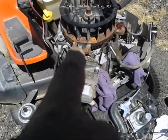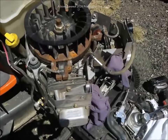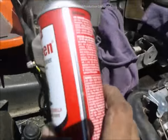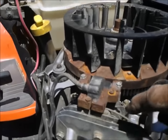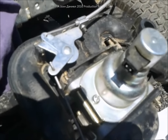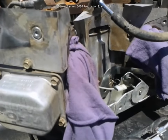At this time you should order your spark plugs, get your fuel pump and new air filter — which is what I've done here. Do a complete service on it while you're at it. Also get a couple of cans of good brake cleaner because it works excellent on aluminum. This was very dirty up in here and caused it to run warm inside the cooling where the fan blows air across the cylinders. I saturated it down with it all plugged off and with a towel over the top, then took air and blasted it out. Now it's quite a bit cleaner and should run a lot cooler.